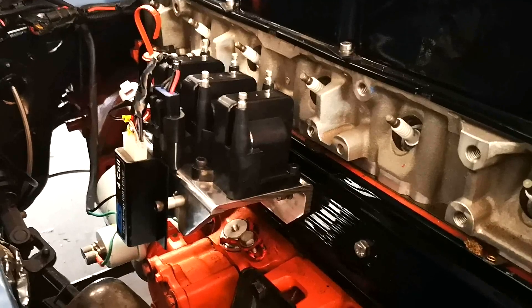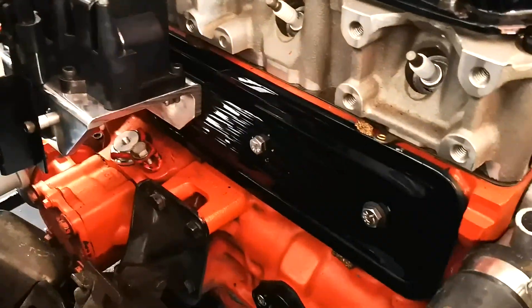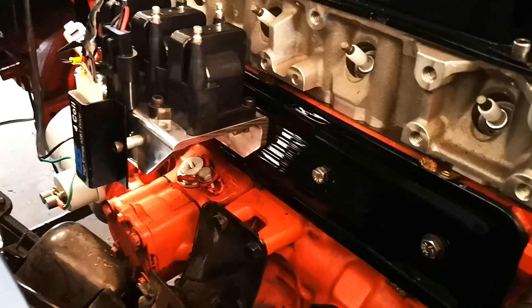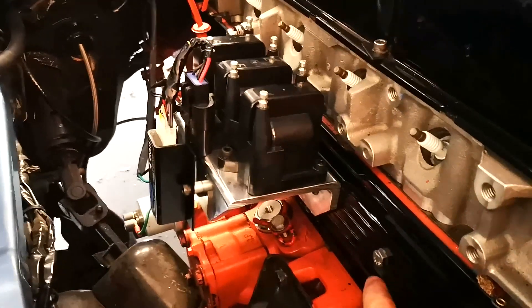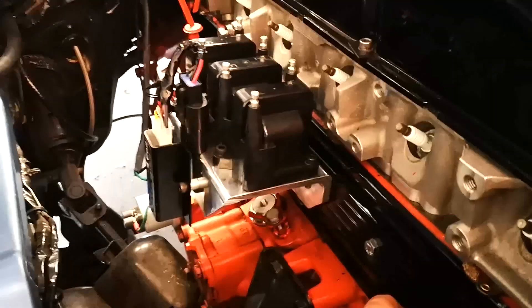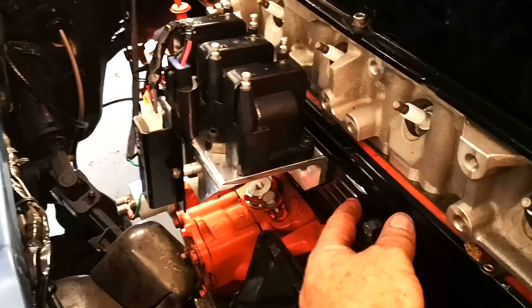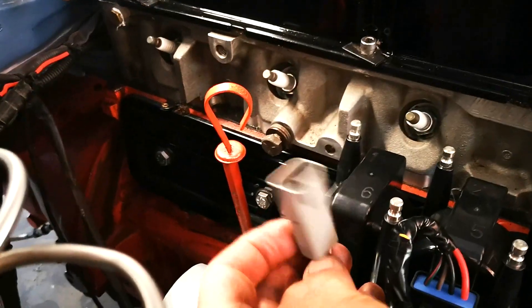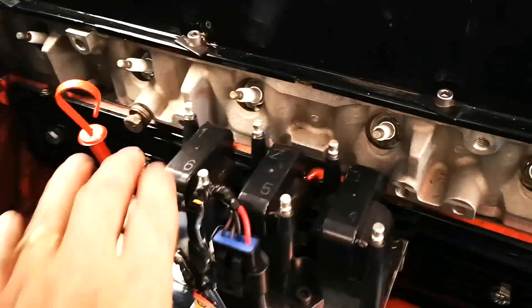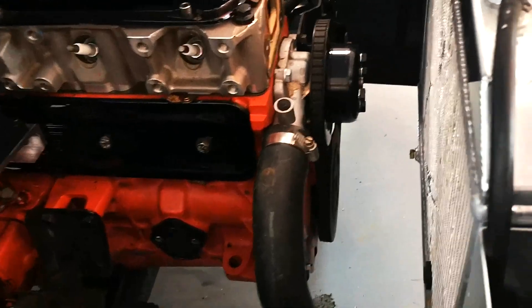You don't see a lot of that little bung in there — as cute as it is, the ignition system is bolted up over the top of it, using the last and the first bolt in those side engine covers. I used the same bolts because I actually had bought these new bolts when I built the engine. They're a bit longer than required — they're a stainless bolt. I put an O-ring, found a good size O-ring, and put it on the cover side of the bolt, then screwed back in through the bracket to hold it on, which should seal any oil from coming out there. That is an awesome looking ignition system. It's got the main electrical connector over here — that should hook up to the ECU. I'll find my leads in a second and fit them up to the plugs.